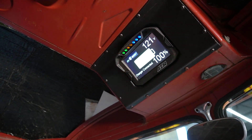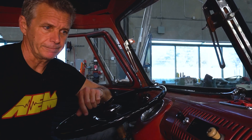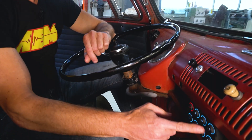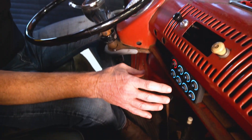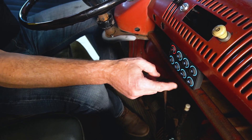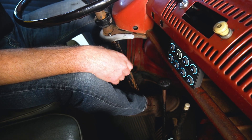The battery's currently at 100%. Notice the shift lights — that's showing the indicator all the way across at 120 volts. Before you started the vehicle, you just pulled a button and everything was awake and in drive. Now: pull the wake switch, hit the high voltage or ignition button, and you'll see the dash come up with high voltage indicated. We're in park. As I hit the ignition, this green light comes on telling you we're up and running. Sam wired in a zero-to-five-volt signal off the brake pressure, so the VCU is looking for brake pressure — if I'm just hitting buttons with no foot on the brake, nothing happens and it won't go into gear. That's an awesome safety feature.